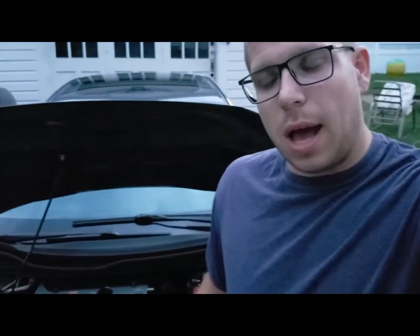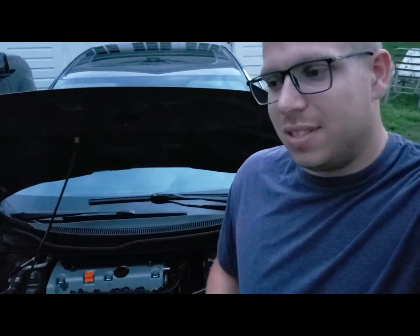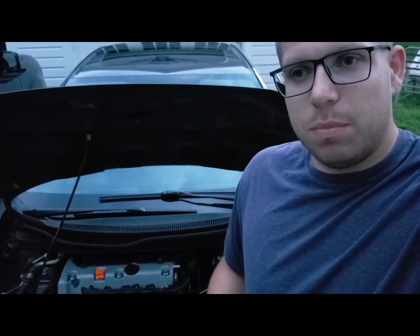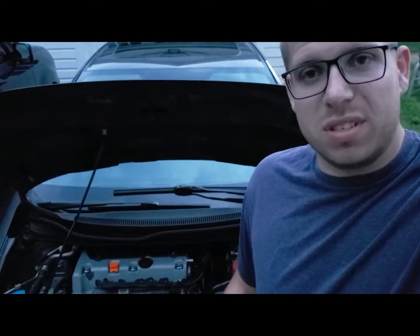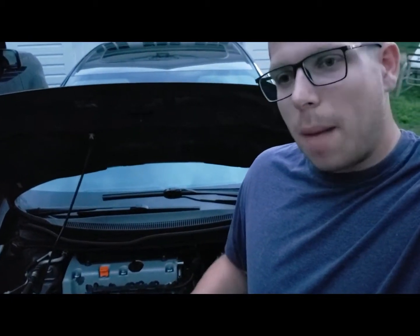It's about a day later. I got everything finished up and I ended up upgrading to the 3mm nozzle. The 1mm just did not want to do much. I got a good amount of knock or pre-detonation out of the way when I upgraded to 21 degrees of timing, but after I started trying to push it a little bit more and noticed that the intake temps weren't really dropping as much, I ended up upgrading to the 3mm nozzle. After the upgrade, I took it for a ride, data logged, ripped on it a little more. It works really well — I definitely like it so much better than the 1mm. Looking through my data logs for the intake air temps, it immediately drops like 3 to 5 degrees almost instantly. So I'm going to run with this.